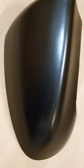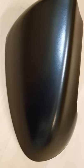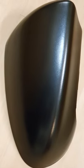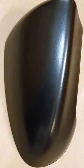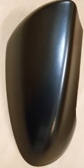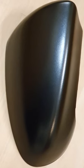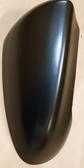Three coats of base coat have been applied — Z11 in this case for the Qashqai. I placed them very lightly with 25 minutes apart for curing, and because it's winter I've taken it indoors to let the aerosol dry out. The next thing is to apply a clear lacquer — three coats — and at that point it should be finished, or if you want a really shiny finish you use compound thereafter to smooth it down. I'm shaking the lacquer can for two minutes and will spray it on.